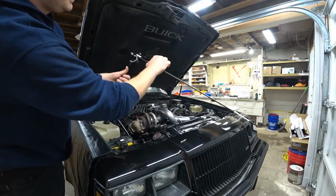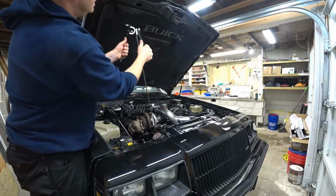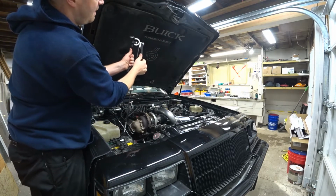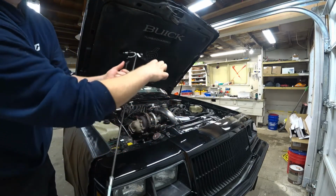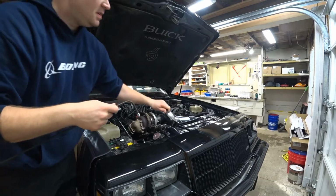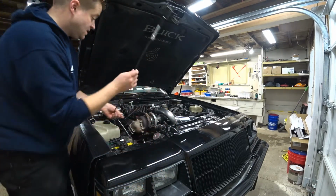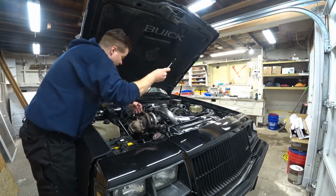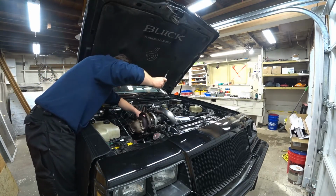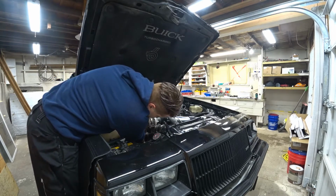And I'm just going to go right off the bat, I'm going to go for 90 degree. And you'll see how nicely this thing does. Stop right there at 90 degree. And we'll loosen it up. Take the tube out. You've got a nice little bend there. So I'm going to feed it down here. Unfortunately, you won't be able to see a lot of what I'm seeing. But I'll feed it and see if I can get this thing to screw in at all.